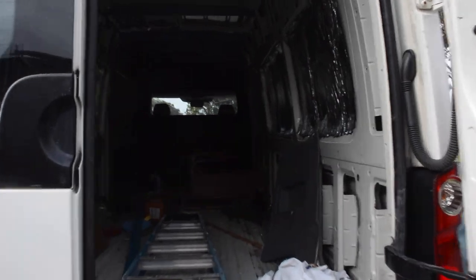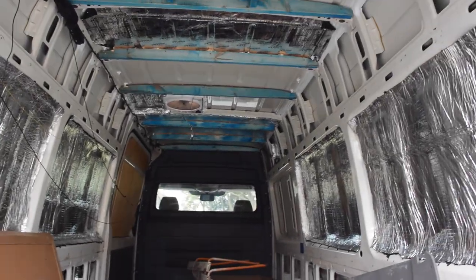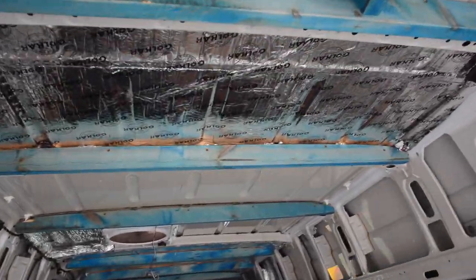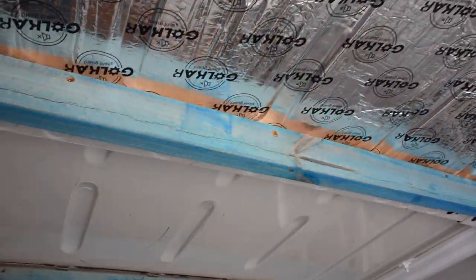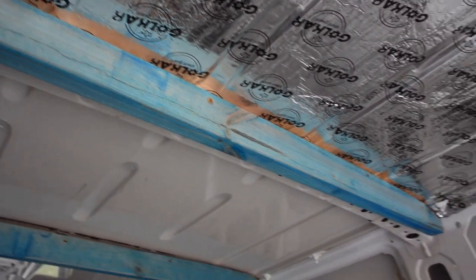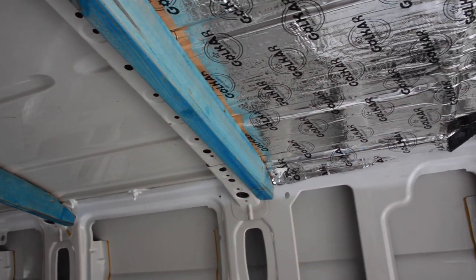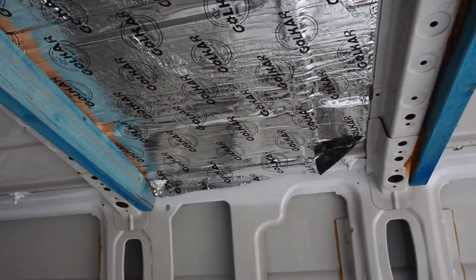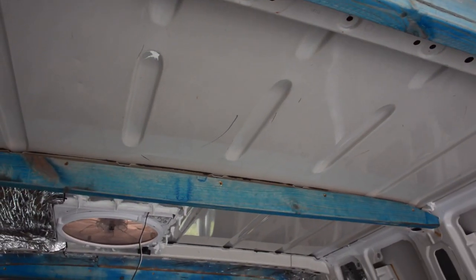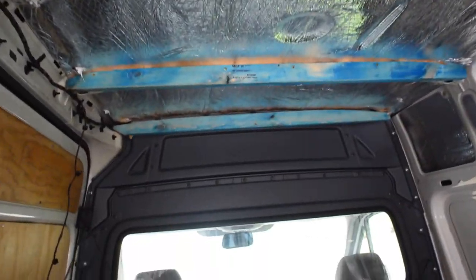So a bit of sprinkles before. I managed to get the other aluminium angle for the roof, for the solar panels, the back ones. So I'm going to have 640 watts of solar. Perfect. So there, those are the other four bolts. I used M8 stainless with nylon washers up the top. Yeah, the wood turned out nice. So we are going to keep this dividing wall.